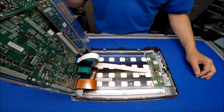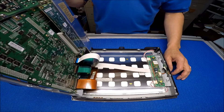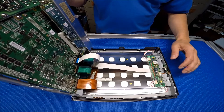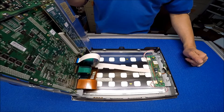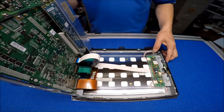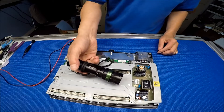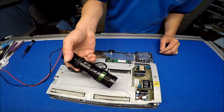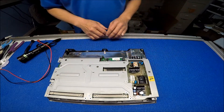Usually the lamp goes out and the inverter fails. Because what happens is when the lamp gets old, it requests a higher striking voltage when you first turn it on, and then it finally overloads the inverter. So the problem is narrowed down to the inverter or the backlight lamp. Next time when you go to field service with your monitors, it's better to bring just a flashlight so you can shine it and quickly isolate problems.